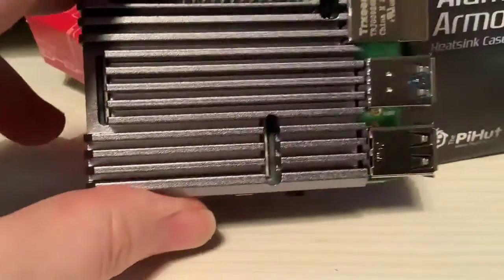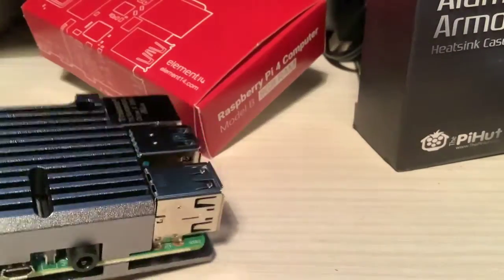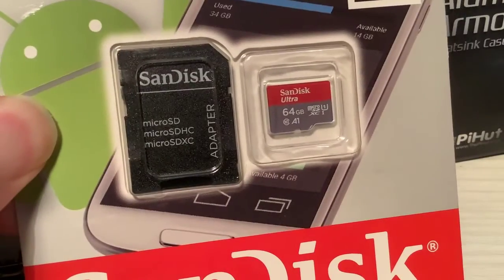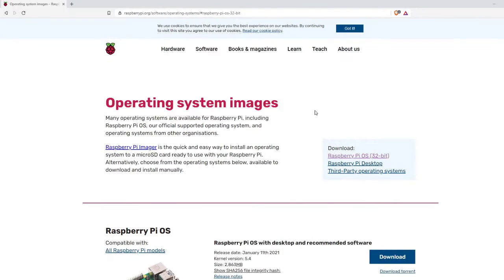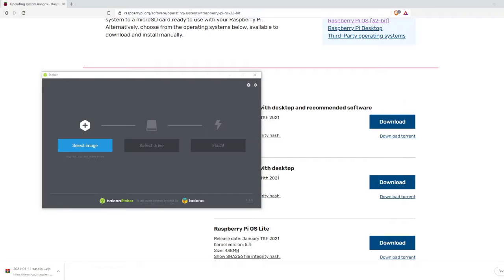So now we're going to jump ahead to the actual installation of Raspberry Pi OS, which used to be known as Raspbian. Again, I recommend SanDisk, and then you go over to raspberrypi.org and get the latest version of Raspberry Pi OS. Download, go make a cup of coffee, it takes about 20 minutes, and then when you come back, we can burn the disk using Etcher. I'll leave links to all these in the description below.